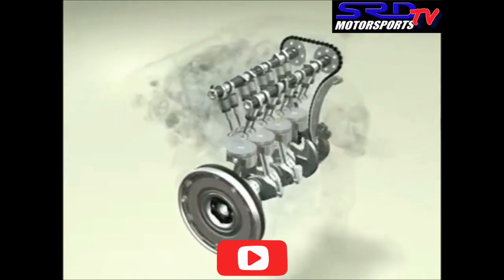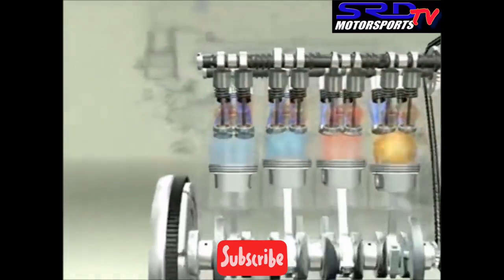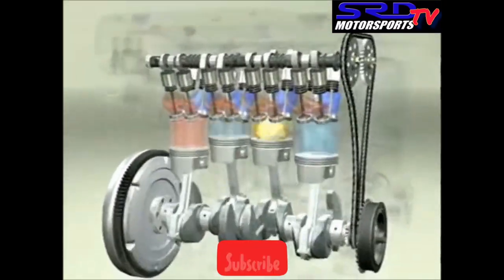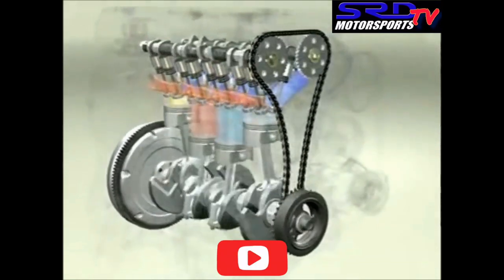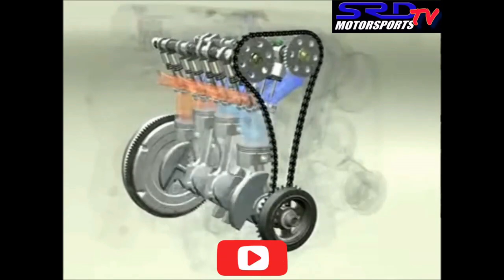That's just one revolution. So imagine at 5,000 RPM, the turbulence is just crazy, right? And that's not even adding the pressure gained from the slight blow-by going past the rings. And that is why when you pull the breather hose from the valve cover, you can feel the air pulsing. That's because the engine has that much turbulence inside the crankcase. And letting it breathe just frees more power. Not really a gain, but more like unleashing the power that already exists. That's just trapped, you know?